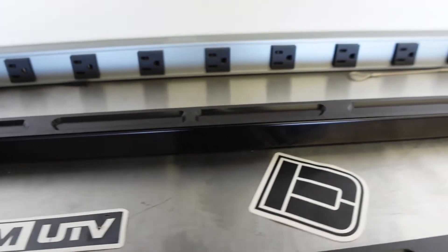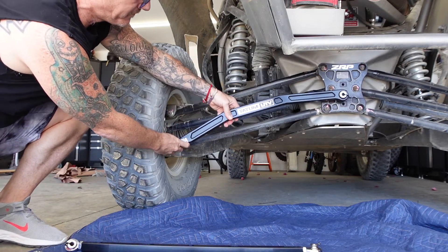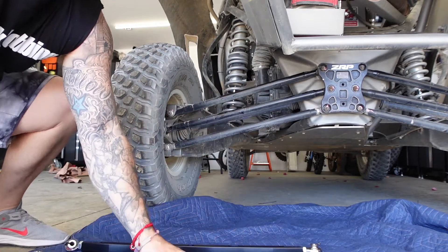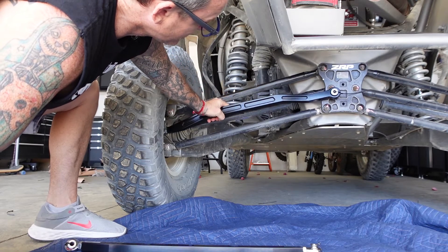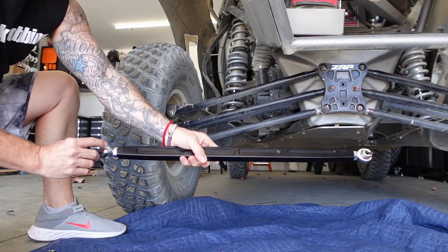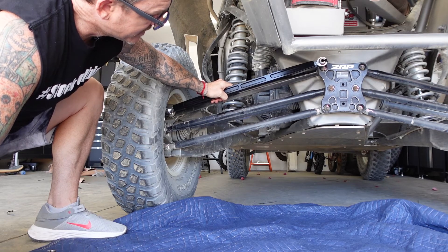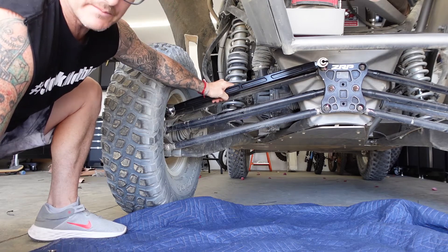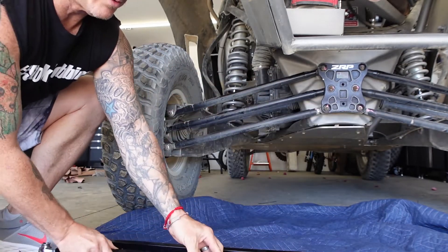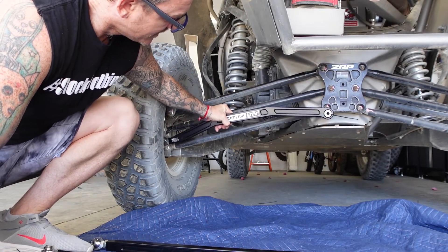I'm going to take you through before and after as we install it. But today this is the update. This is the bottom one — it's fixed there. I'm going to get more ground clearance from that kink, so you know you got a couple inches there. More ground clearance and adjustability in there — that's key. This one's got adjustability on both sides, which I believe is to really dial in the toe. The car is not going to be 100% straight, so anything you can do to fine-tune it in the heims is going to be helpful. It's really light, a really nice part, nicely machined aluminum. It does have the adjustability — it's going to be interesting to compare the weight to the chromoly, but it's going to look good. I like it.